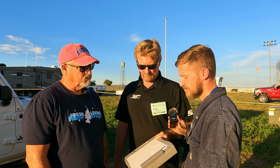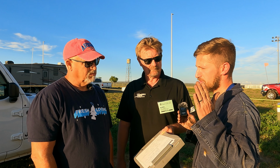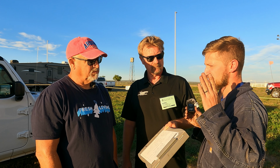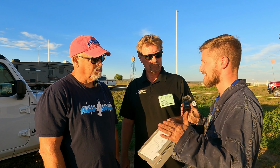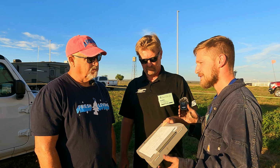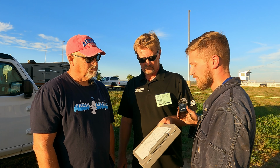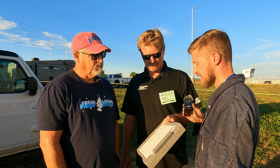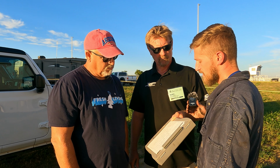We checked your rear anti-sway, your rear track bar as well. And just a little bit of movement in the frame bracket side, but I wouldn't say it's excessive. Typically, I see more in the rear track bars on these things. So it didn't look like an excessive amount to me. Boots looked okay on that one, as far as I could see. So that one, not quite as much of a concern.